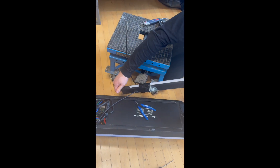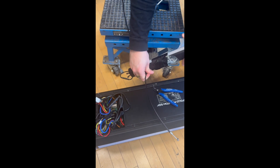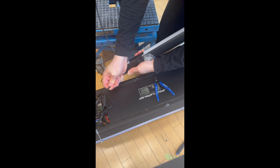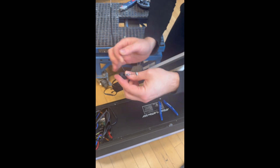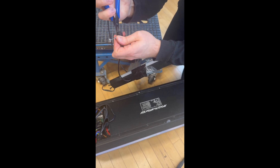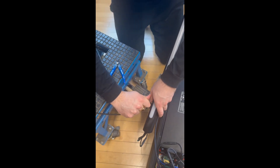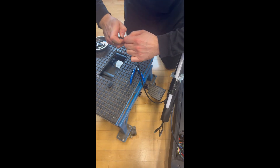Push the cable inside the stem. A brake line might be in the way, so pull the brake cable completely out to make it easier. To do so, remove the rubber covers — you can pull them out while pulling on the brake cable, or just cut a line in them, because you'll need to do that to reinstall them anyway and you won't be able to tell that you made a cut.